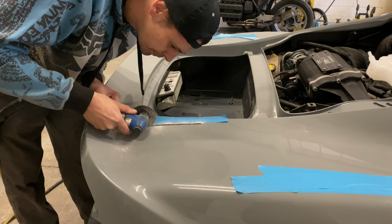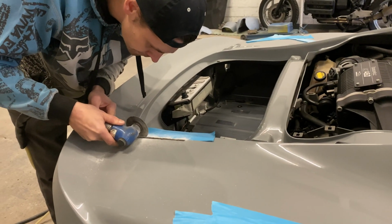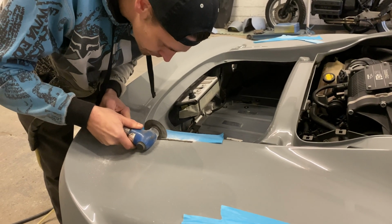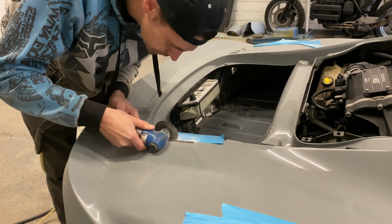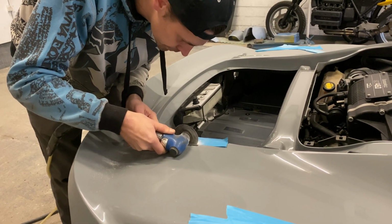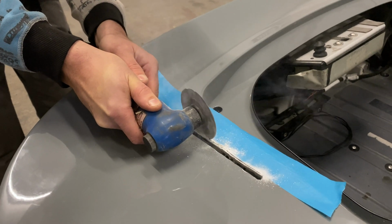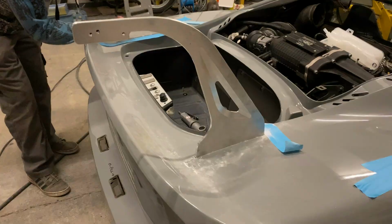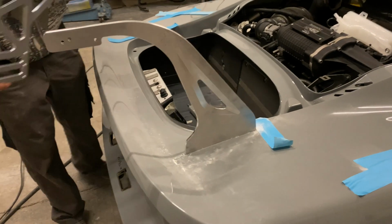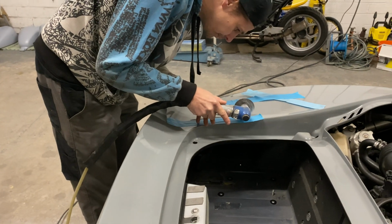When I got to the body shop, we got straight to cutting up the body of my car. Still a bit scary, if I'm honest. These slots are for the wing uprights, and as we decided to change the spec of the uprights to be 2mm thicker to give us some extra strength and just a little bit more in reserve, we had to make the slots larger. They fitted well. There'll be lots more prep after this point, so don't judge the gaps too hard, as they will be tidied up in the full pre-paint prep stages.